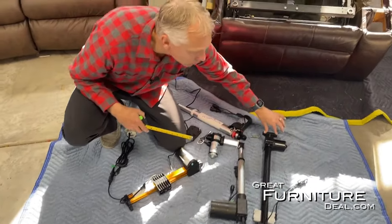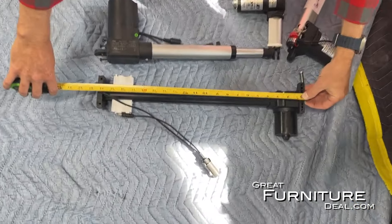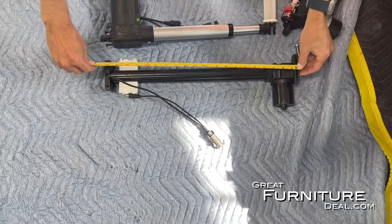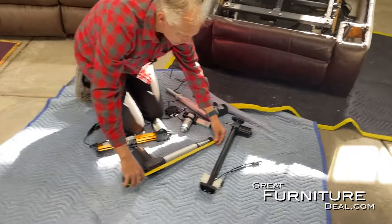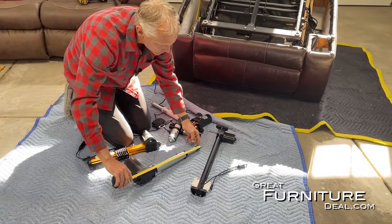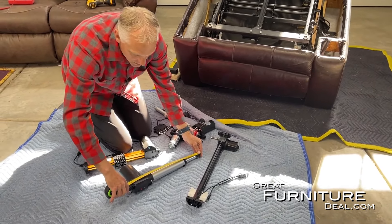This right here is a double bolt motor, just like we have in the recliner behind us. What we want you to do is measure end to end — on this one we're at 20 and 3 quarters inches. Sometimes even taking a picture with the tape measure laying next to it helps us. On this one, fully closed end to end, it measures about 19 inches.